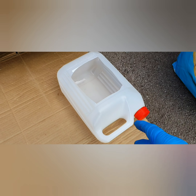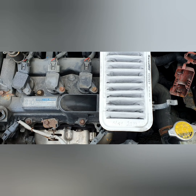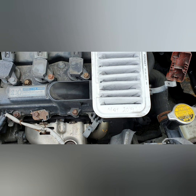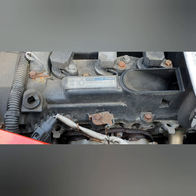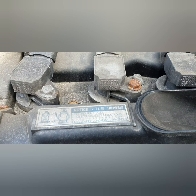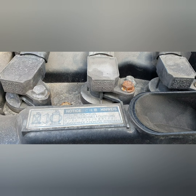I've got an old screen wash bottle to drain the oil into. I'm going to drop the oil out of the sump and then jack it up so I can get to the oil filter. The filter's a bit dirty but it looks like it was changed in May 2019, about three years ago. These C1s, Peugeot 107s and Toyota Aygo vehicles are all the same — it's a bit strange to see the word Toyota on a Citroën.